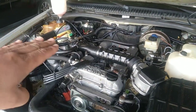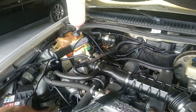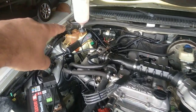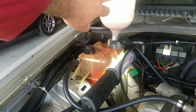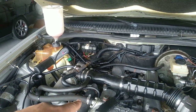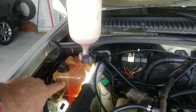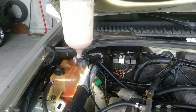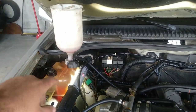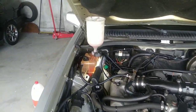Now, the engine rises in temperature, the valve — that thermostat — opens, and the second circuit will open as well. The antifreeze — I have this tool here so you can see the level of the antifreeze. When this valve opens, that level there will fall, and normally it should fall near to the final level. Once it does that, you take out the tool, close the circuit, and wait until the fan kicks in. Let's do it step by step so you understand better.